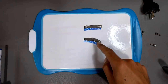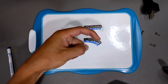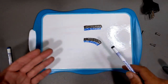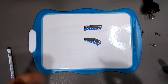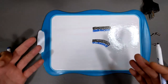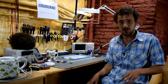So when you have these two pieces of metal and you heat them up, instead of staying straight — because the top piece of metal expands at a different rate than the bottom metal, but they're bonded together — it naturally curves the piece of metal. The reason they use these things is because they are extremely resilient. It's two pieces of metal; you can heat it and cool it like 80 gajillion times and it's not going to fail. You can't have electronics in a tea kettle because there's just too much heat — 1400 watts in a tiny little place is too much, and heat is the enemy of electronics. So you need this bimetallic strip, which is essentially an electromechanical off switch that trips at a certain temperature.